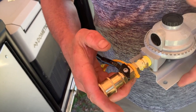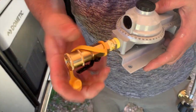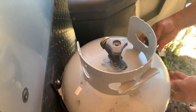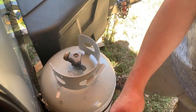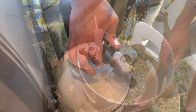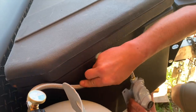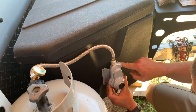Make sure this side ends up on the same side as the top of your regulator so you can actually use it. Once it's rotated into position, tighten it up to keep it from turning. The trick is you don't want somebody to walk by and hit the valve, break it, or cause it to come loose and leak gas. We're going to put it on now just to test placement and mark these holes with a pen so we can drill them and put some bolts through.